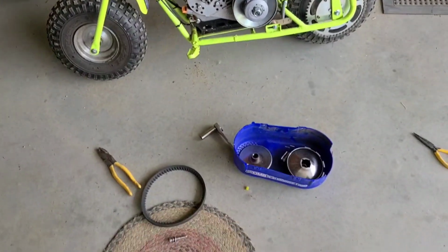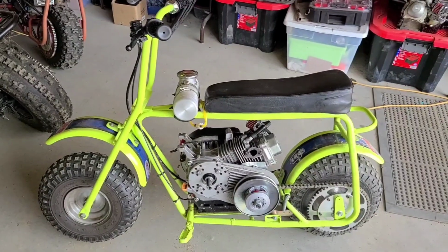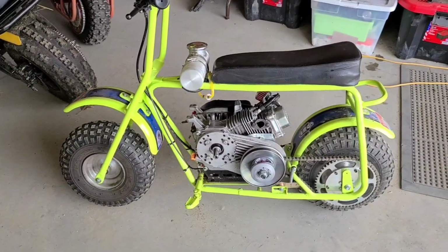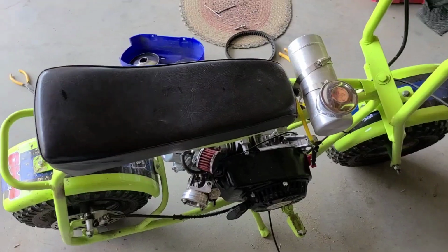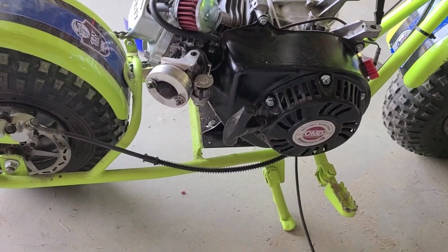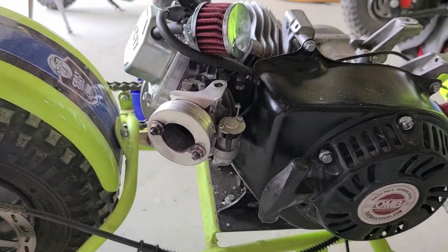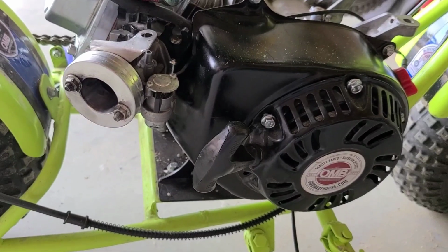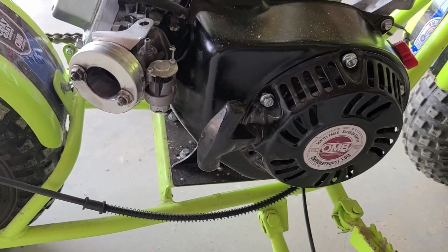Alright, guys, before we finish putting that torque converter on there and going out and having it out with Miss Terra Firma, we better test fire this thing. In order to do that, we're going to need fuel. In order to get fuel in the motor, we're going to need carburation. As this thing sits, we have a stock 212 carb. Now, this is an adjustable carb, a non-EPA version, and it's got the 38 main jet and 140 emulsion tube. I'd like to see a little something extra with this cam and these 22s, especially with the non-Hemi valves and the increased flow that we should be getting.